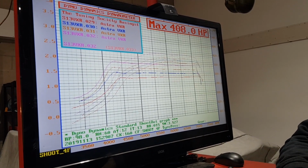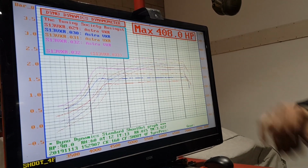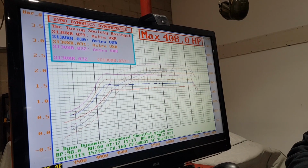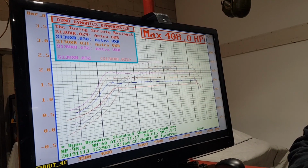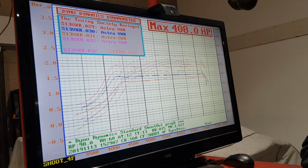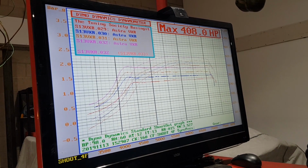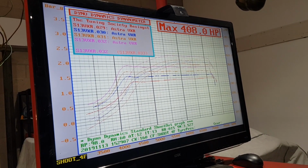But whenever a power curve starts flattening like this and airflow starts becoming flat, you're just not going to get any more. You can try more boost, but you can see how it leans over earlier and earlier the more you build up. So if we went big boost like 2.2 bar, you'd probably start getting into high exhaust pressures and just stop gaining power. You might get like 420 if you really pushed it, but I think we'll leave it backed off a bit on 97 RON, and then see what we can do with the water meth to boost the octane.